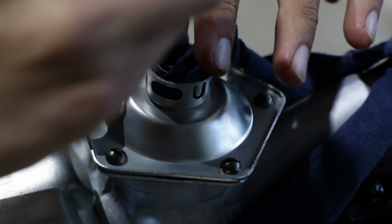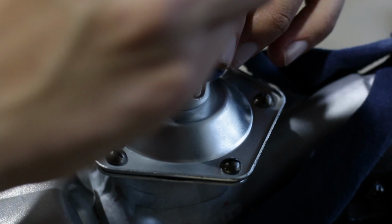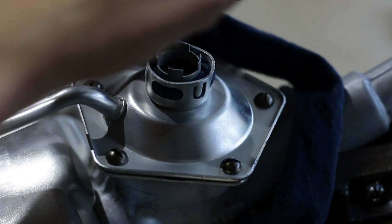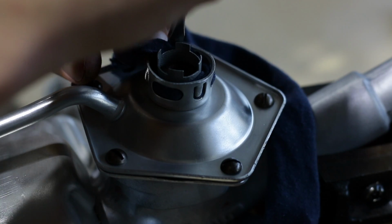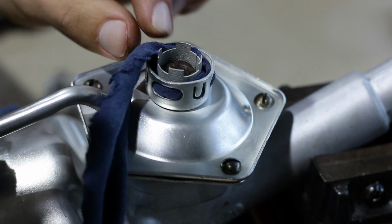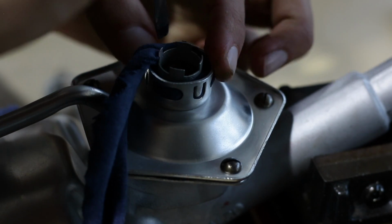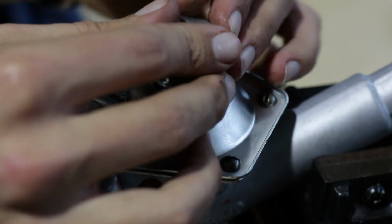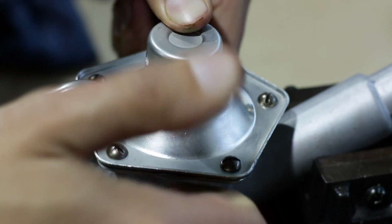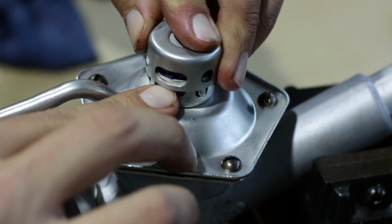I don't have a new air filter for this booster, but a bit of clean cloth should work just fine. It needs to let air in, but keep any harmful particles out. Any air that goes through here will end up in the engine eventually, so it should be kept clean. But this car will not be doing thousands of miles on dirt roads, so a piece of cloth pinned into place under this retaining clip will be just fine. Plus, there's nothing on the market to replace the original filter.